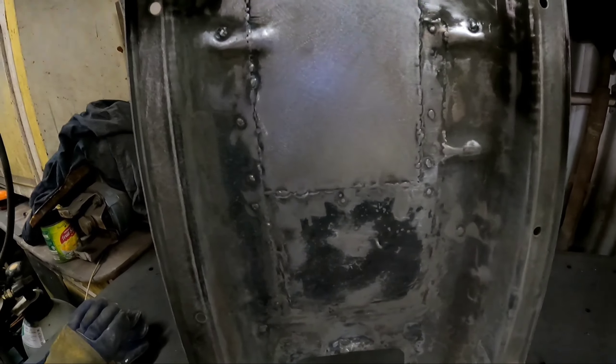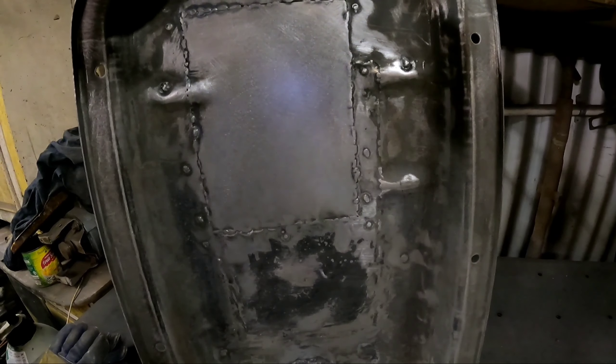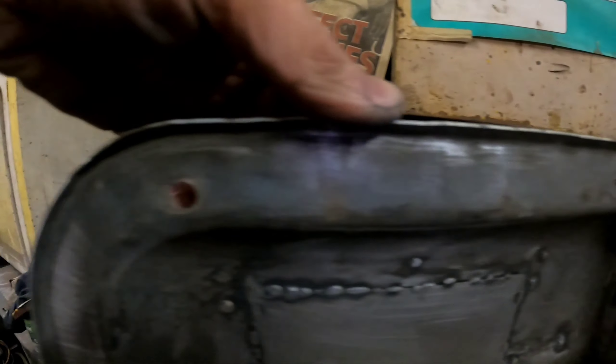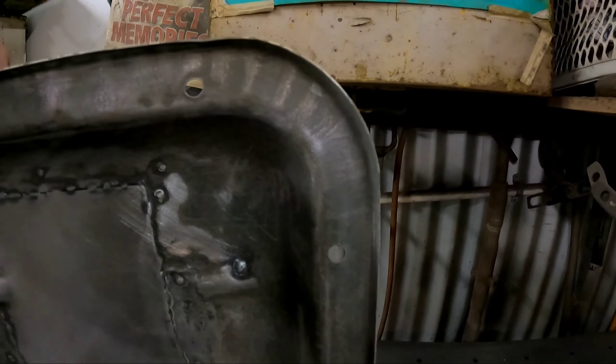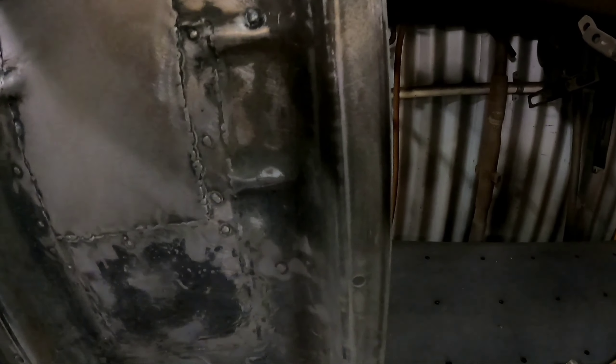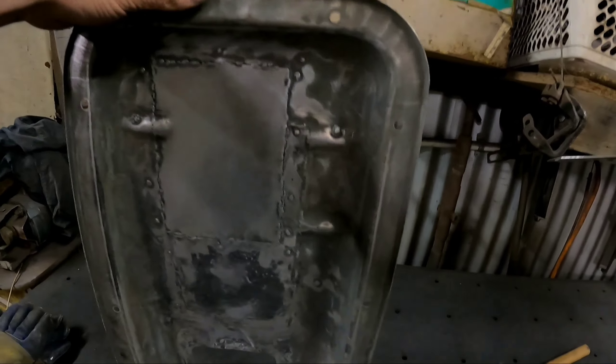So you've got all this stuff here, but what I'll do is get that Sikaflex. A bit of a trick is you smear it on and you always see it, so what you do is wet your finger up, run over it again, and it flattens the run out — makes it look a hell of a lot neater. It's not crucial because there's a big transmission going to be covering all here. But it's just something extra you can do to make your work look a little bit nicer, especially if you're doing panels that are overlapping and you just want to seal that edge. Also around this edge here where that sealant was, I'm just going to get some sticky adhesive-backed sealant strip and just stick it on. So if I ever have to pull this cover off, just undo it and it pulls off, screw it back down, it seals again — it's not stuck to the floor like it was originally. It doesn't need to be. One job out of the way.